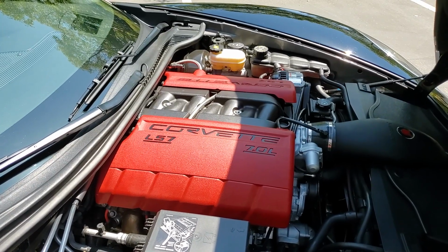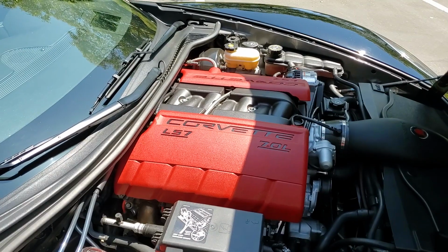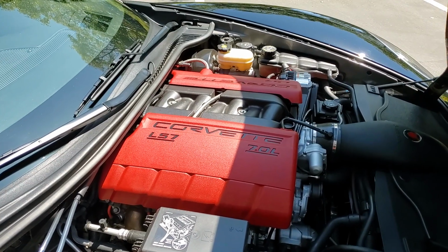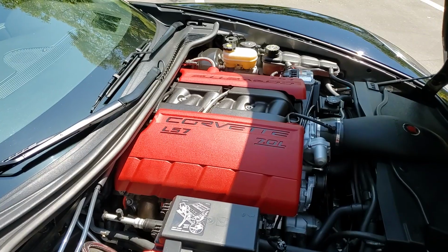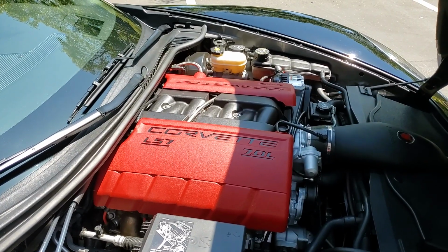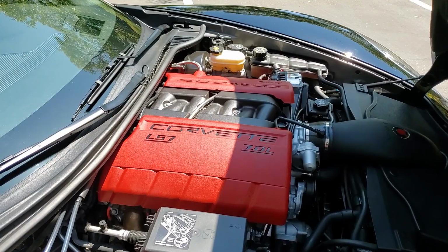So that's Advanced Induction. They have, I believe, a 280cc program porting for it, and Richard at WCCH, he does great heads as well. So I know plenty of people that run his heads and have no issues using the bronze guides as well. So AHP does have the Moldstar guides. It would be nice to have Moldstar guides in somebody else's porting program, but unfortunately that's just not the case.